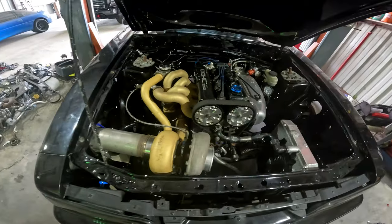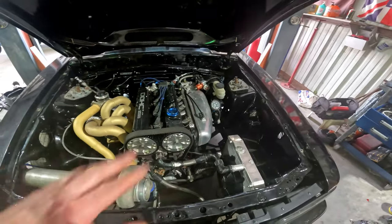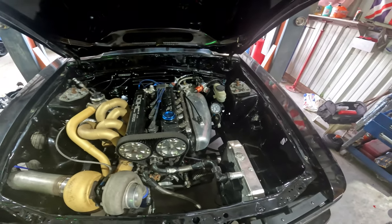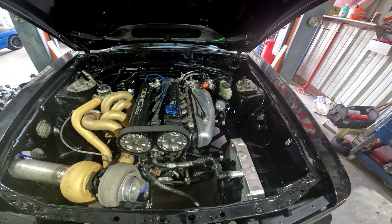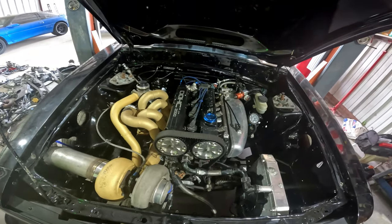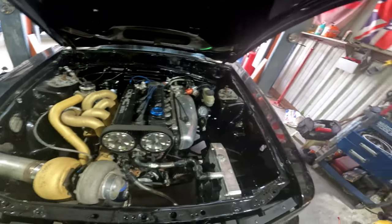And relatively clean. A couple little more things to clean up. Change that fuel pressure regulator over into the far corner over there once I make a new hose. I'll have a different oil pressure gauge going interior. It'll be electronic. But so far, so good. I'm pretty pleased with it. So I'll post this up pretty soon, and then y'all can look at it, and hopefully within the next week we'll be taking it out to the track and hitting some 60 foots. Because now that I see the air fuel ratio was good all the way to 17 pounds, that lets me know that I'll be able to at least do some 60 foots.